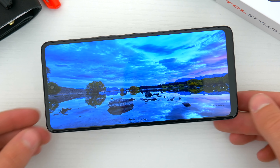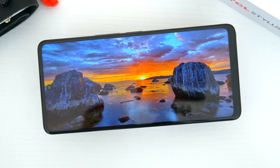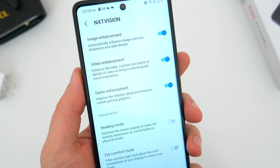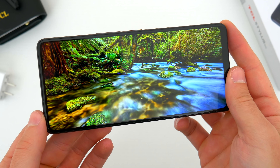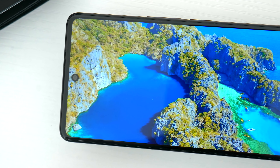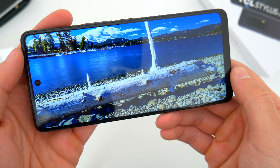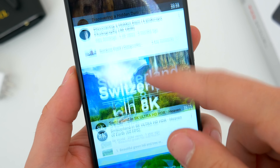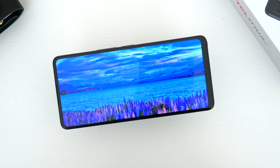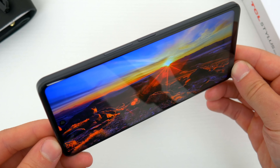As far as the display, the 6.81-inch screen on the TCL Stylus is an IPS LCD panel coming in at a resolution of 2460 by 1080, for about 395 pixels per inch. I actually think TCL delivers a great viewing experience for what this is. Paired with their NextVision enhancements — which I do think make a difference in color, contrast, and the overall look — this phone offers a relatively bold and punchy setup that almost seems better than what it is. At this big size, 1080 resolution is definitely a must-have, and there's plenty of screen real estate. But it is still just an LCD screen, so it isn't particularly bright, and there's no high refresh rate here either — just a 60Hz panel. There are some $250 to $300 devices out there now with 90Hz panels and OLED displays, so if screen quality is most important to you, other phones offer more.